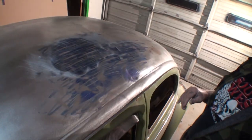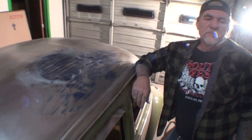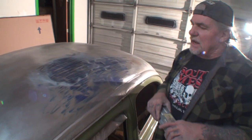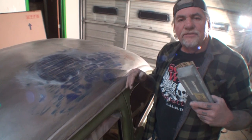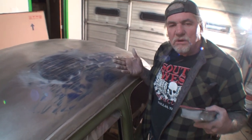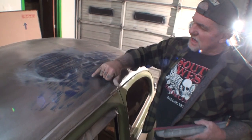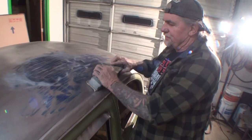Now, Minnie was asking, why don't I use spray paint on it? I'm going to tell you why I don't use spray paint. The reason I don't use spray paint is because if I spray painted that, the tools that I am going to use on it would literally create a fire, or should we say it will melt onto the metal. So what we need to do, because we're going to be heating this up to work it. Do you see what I'm saying? Yep. So by using this real thin dye, or should I say marker, that won't happen.